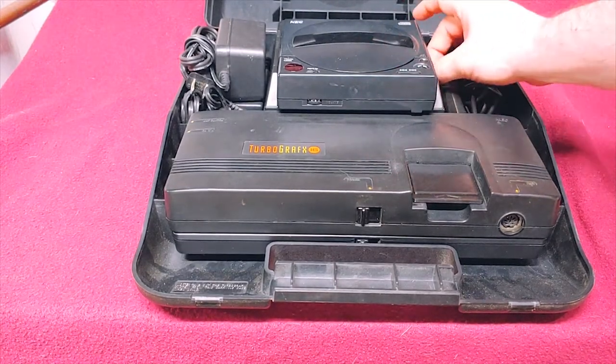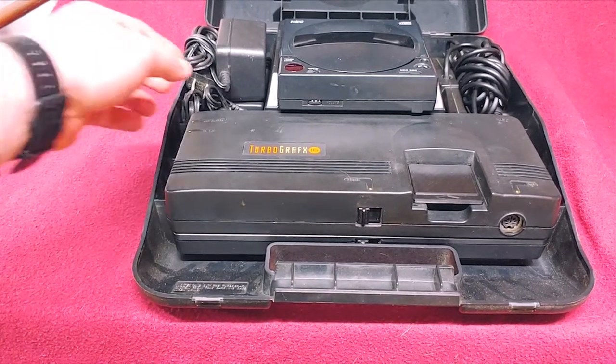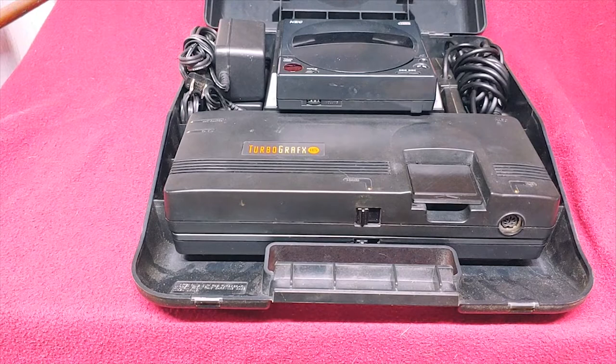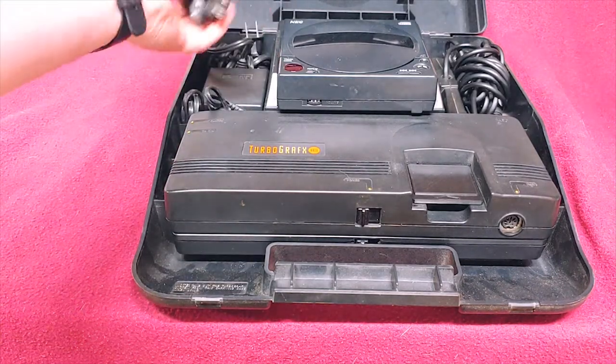Also, on the CD unit itself, there is something else that is problematic. I know it seems like a lot to go through to actually own one of these systems. There is a white gear. It's called the white middle gear. Thank goodness there are stores out there that are finding these things and reproducing them. That gear is made of a plastic that over time likes to swell and then it jams. So then suddenly the drive just doesn't work anymore. You have to replace that as well.